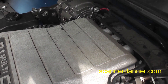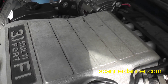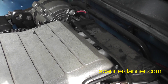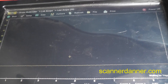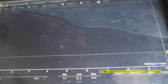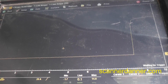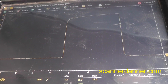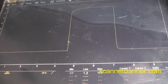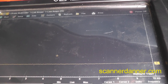So again — MAP sensor code: is there a MAP sensor problem, or do we have an engine running poorly causing a MAP code? It is the latter for sure. There we go — engine just stalled. Can you crank this for me please? 15.6 amps — car just died. Go ahead and start it again.